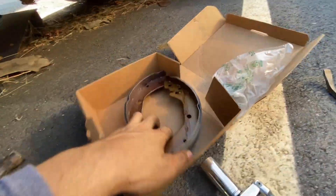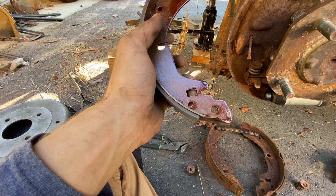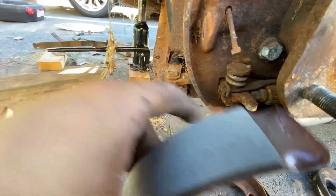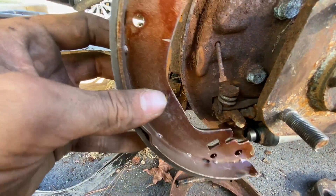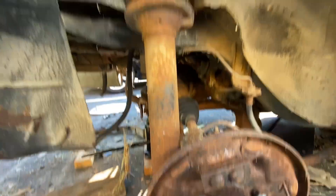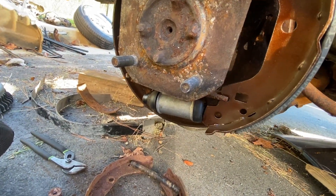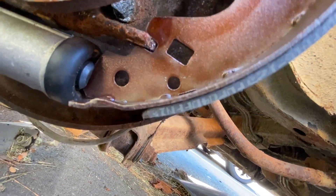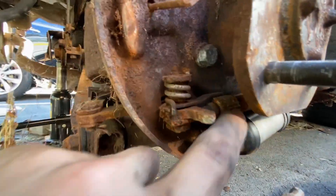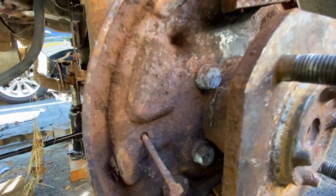Let's go ahead and get the new shoes put on - brand spanking new. All the extra holes go at the bottom - that's where the emergency brake adjuster wishbone-looking piece sits. This goes to the emergency brake arm, so this goes in like so. There's no right or left to these on these cars - they're all exactly the same, all four of them, so you don't have to worry about getting them mixed up. On the other shoe, this little groove slides right in there - line the notch up with the bottom of that brake pad. I'm hoping this will spin free just like the other one, but the other side was seized. Luckily, I was able to get it to break free.